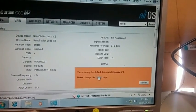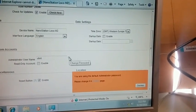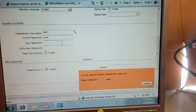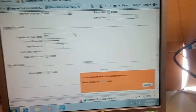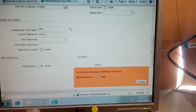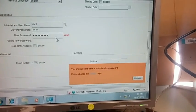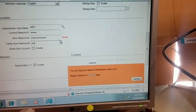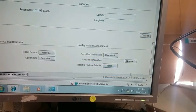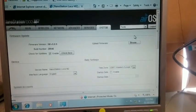The first thing you need to do once you're in here is change your admin password. Failing to do this, it'll keep bugging you. In the newer firmware versions, you can't make any actual changes because it won't allow you to save whatever you change. Set up your password — it's a weak one here, just numbers, but that's okay. Click the change button and apply that.